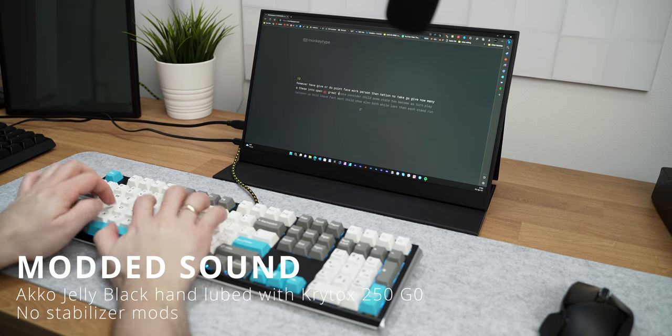There is also a mouse control function. Press Function plus right Alt plus Numlock. This enables mouse control directly from the keyboard. The control is done on the numpad arrows, and 0 is left click while delete or the point key is the right click. This is neat if you don't have a mouse or need to do something rather quickly. When you are in this mode, the M will shine on the indicator lights, which are nicely hidden in the top right between the 4 added keys and the numpad keys.